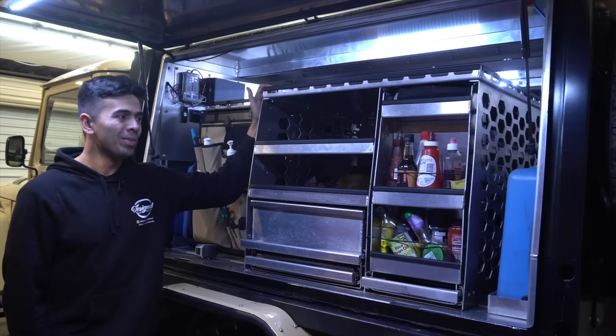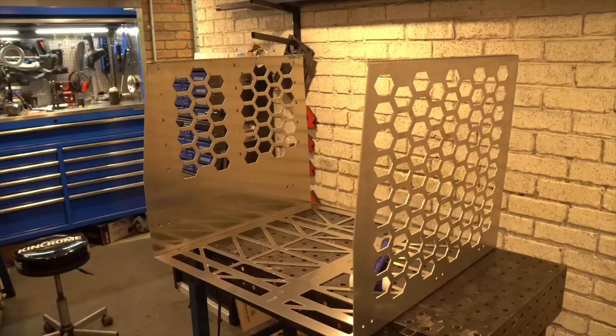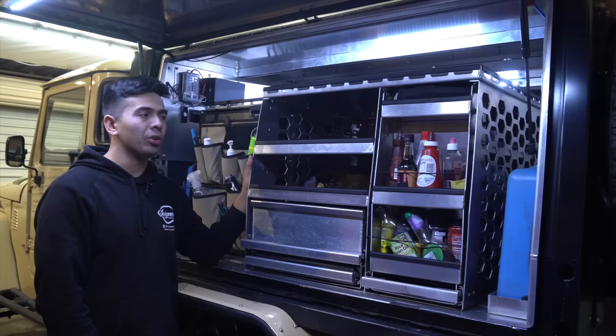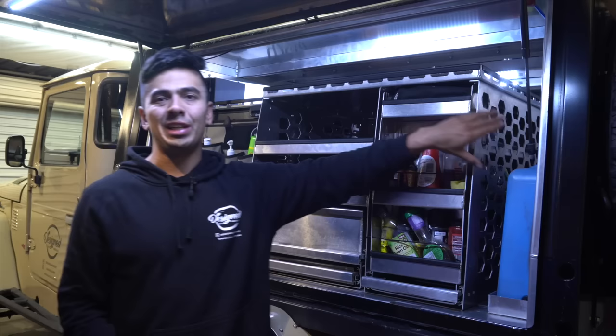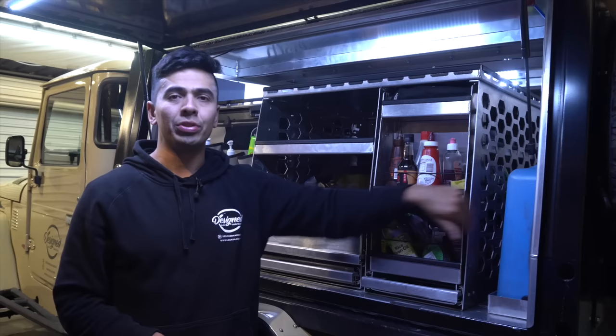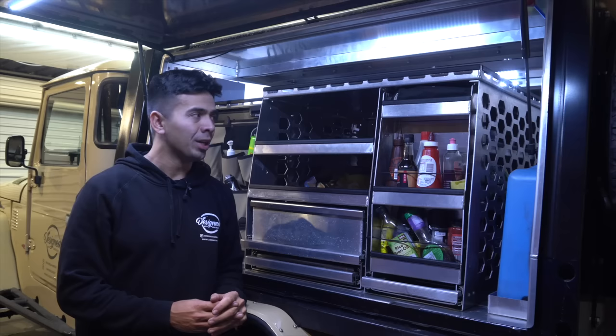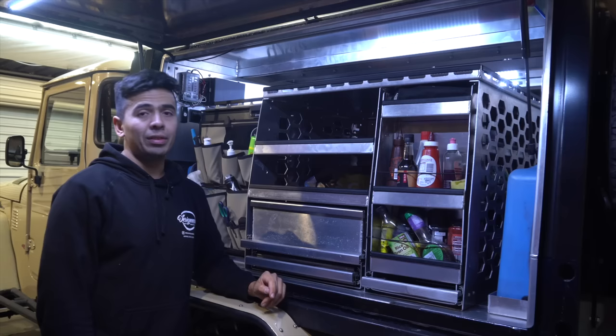I've actually got two shelves here, and up top I've got a shelf joined with the fridge cage — plenty of space for additional storage. I've been keeping a table and miscellaneous items up here. For the carcass I've gone 3mm aluminium and taken a heap of weight reduction out of it because I can — you don't necessarily need all the strength. Some people may choose not to put skins on the side, but I quite like the idea: if you have something soft against here like a pillow or bag of clothes, you can jam it in and it won't affect the pantry opening and closing.